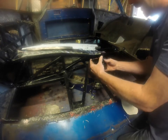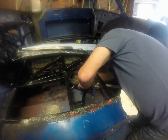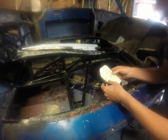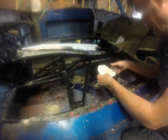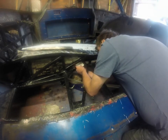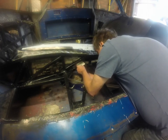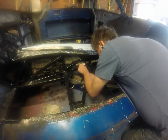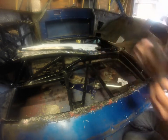This is the original RX-8 gearbox mounting — it bolts on under there. And this piece follows the same pattern the other way up. It goes in here. Looks like this is way too big, so let's cut that down. The objective is that I can get the mounting rubber to bolt through just here, with the thread just clear of the gearbox. I reckon that will do for a Mark 1.